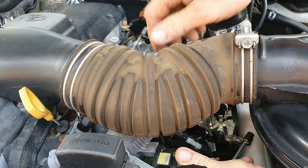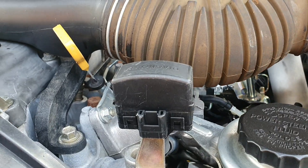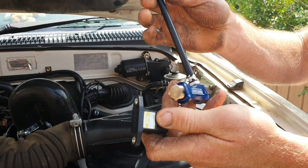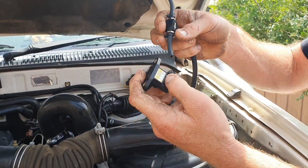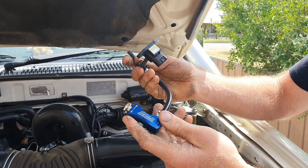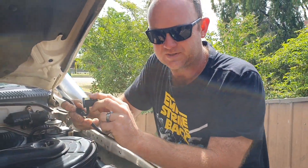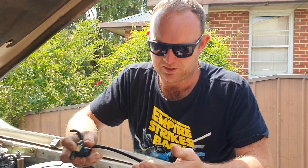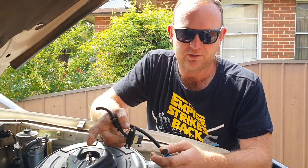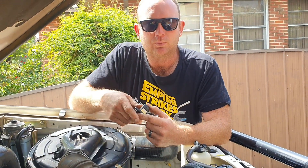You have a vacuum hose that goes from there to your manifold. When you tap that, you cut it and use this device — one side goes into the sensor, the other goes to the manifold. Pretty much all you're doing is tricking the boost pressure sensor into thinking it's getting say 10 psi, when it's actually more. I wound up getting 18 psi out of my standard turbo.